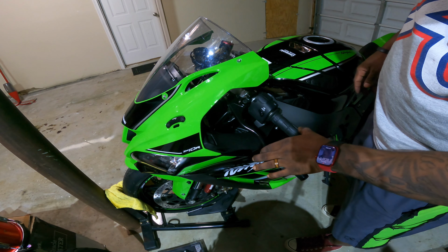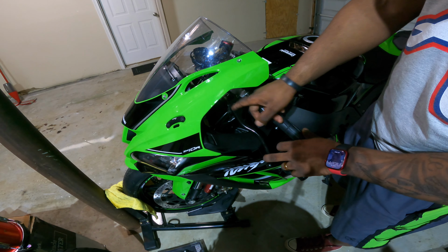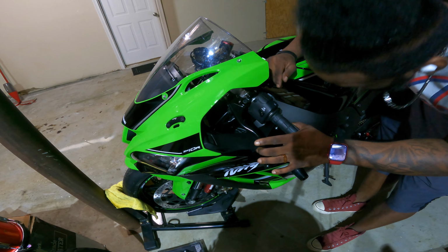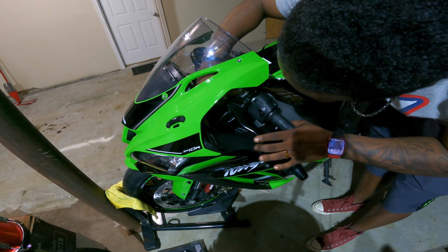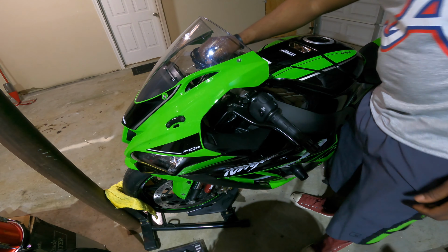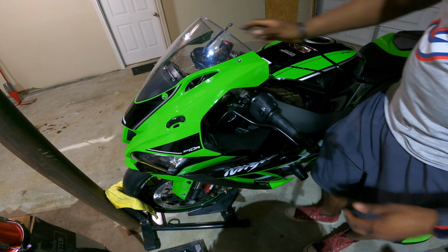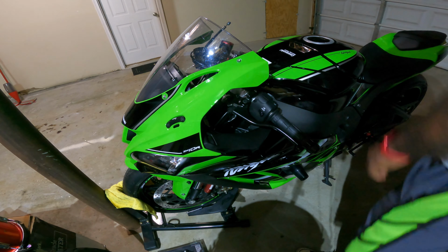Just try to remember your lever. Rule of thumb we used to use at the shop, you could put a nickel or a quarter in there, you know, you would be fine. A free play, so we're just gonna loosen this up. All right, just like that. Clutch lever is out. Really not that bad, so now let's get that loosened up.